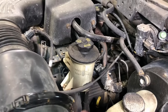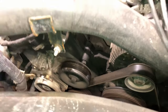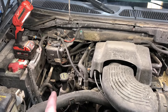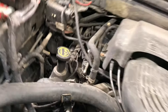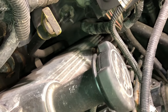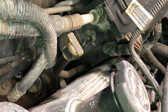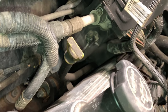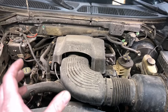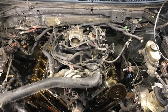What's nice about these is you don't need to drain the cooling system at all, and you don't need to discharge the AC system. Look inside — the AC accumulator is pretty far away from the valve cover, so there's generally enough room once the lights, harnesses, dipstick tube, and similar items are out of the way. You can leave the AC system intact. This is definitely one of those jobs a do-it-yourselfer can do in their garage without any real special tools.